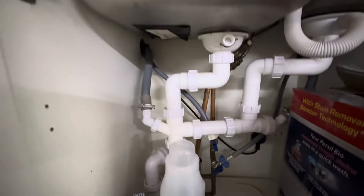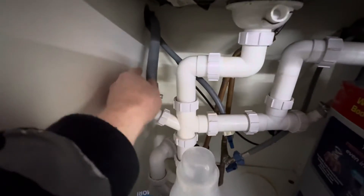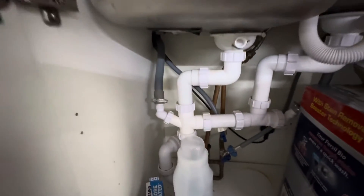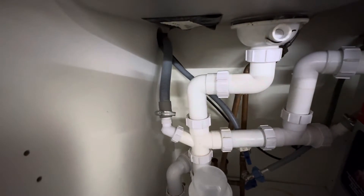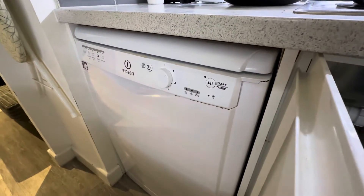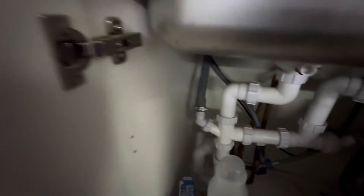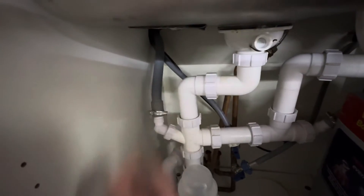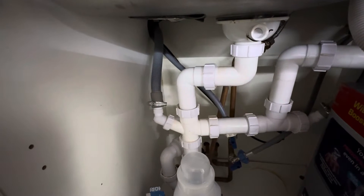The problem you'll find is you'll have to pull the plug through the hole. Often the waste pipes and water supply pipes are done in so tight that if you pull that dishwasher out, it will only come so far. As is the case with this one, where you've got to disconnect the waste pipe. That's not really something we should be doing as PAT testers. This waste pipe is really tight, and if I was to force and pull that dishwasher out to check the flex behind, you could end up damaging these pipes, splitting the pipe, and there'll be water all over the floor — leaving yourself open to an insurance claim and you'll not have a very good day.